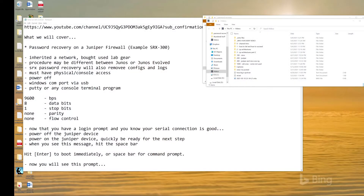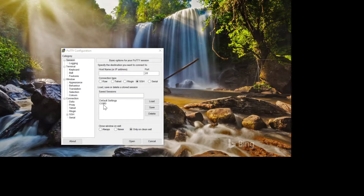With that COM port number, you can configure your terminal emulator — PuTTY, TeraTerm, MobaXterm, or whatever terminal emulator software you use to console into a device. You need that COM port number to carry out the next step in the process.